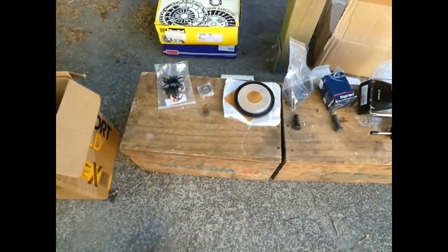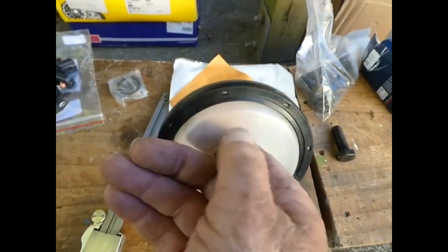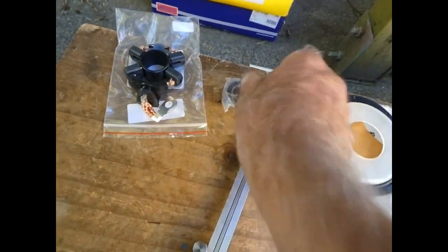While the gearbox is off, it is suggested to replace the crankshaft rear oil seal. You can do that in situ, and a new seal is quite cheap. Comes complete with a guide for putting it on. Ditto for the crankshaft spigot bearing the gearbox input shaft fits into.